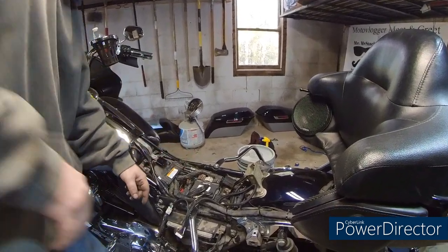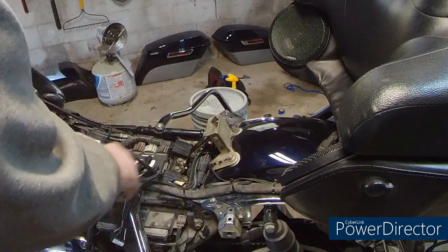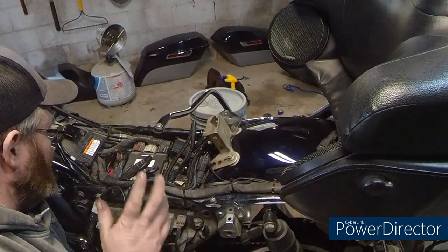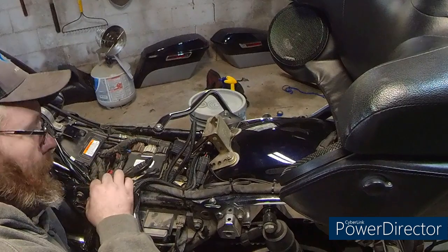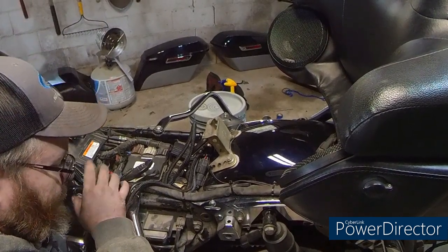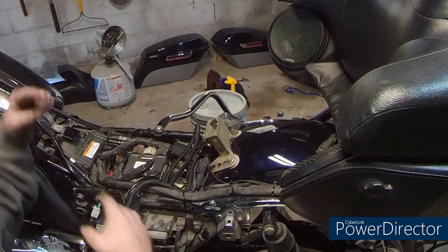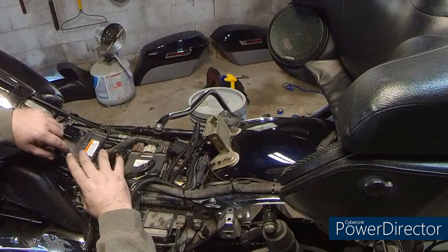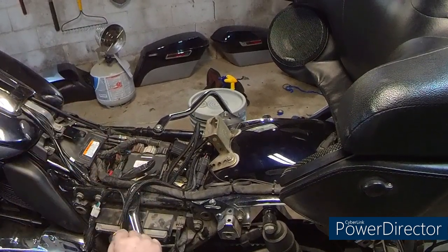You can see we've got the wire on - all zip tied up, with the wire all running nicely. We went ahead and got a new battery. Last year, beginning of the season, the bike was acting funky - it had been on a battery tender all year and didn't want to start. We ended up taking the new battery with us just in case but ended up riding all year last year with it. I pulled the fuse box off to get down in here. Your battery has a place on the top and a place on the side where you can screw stuff to. All my accessory stuff I screwed onto the side terminal, then put everything else on the top, just to neaten it up some.